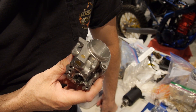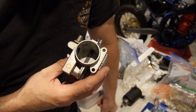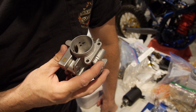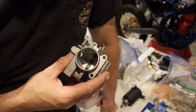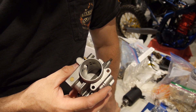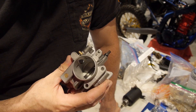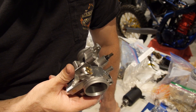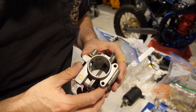This is not something that you just mess around with in your garage. If you choose to do this throttle body mod, be prepared to send it to the only person I know who does it correctly — Dave Lindsay over at Lindsay Machine. Just keep in mind: if you're keeping your motor stock with a stock piston and stock stroke, you could lose low-end power. Maybe you'll gain a little upper RPM power. But if you do a big bore and stroker kit and want to do this, just send it to them.